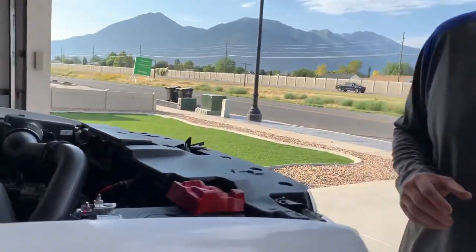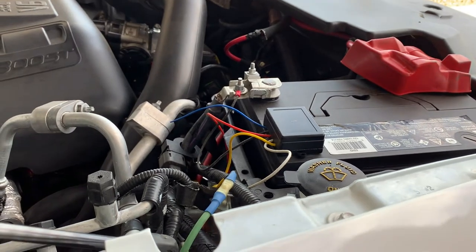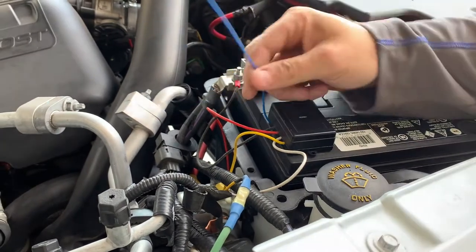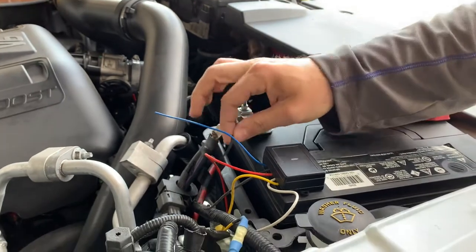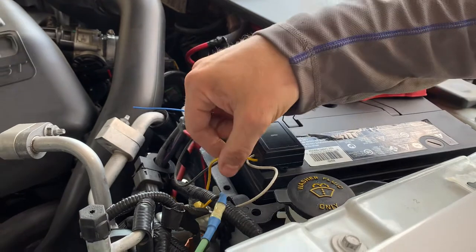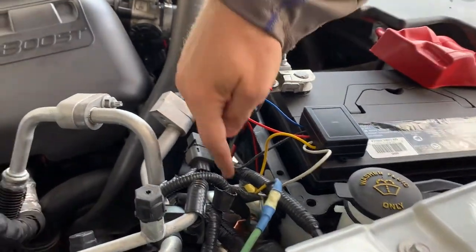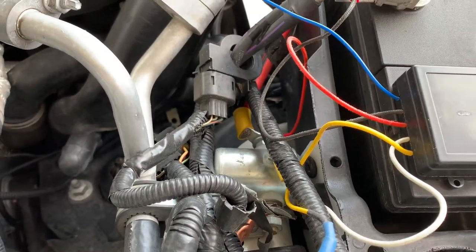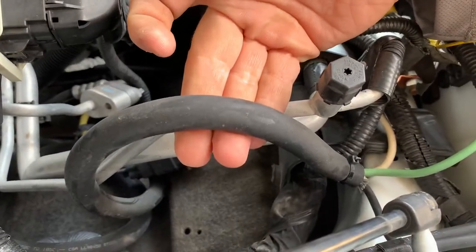It's a very simple setup underneath the hood. We've got three wires coming from the plow up to the front. This is our remote receiver. You've got your blue wire, which allows the remote to communicate with the receiver. You've got your black that goes to ground, your red that goes to your positive terminal, your yellow which is your up function, and your white which is your down function. You've got a solenoid right here that takes the load of the amperage being thrown back to the plow. And that wire right there is all there is running from the battery back to the plow.